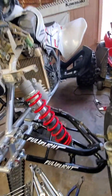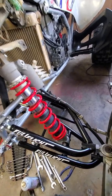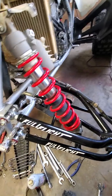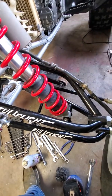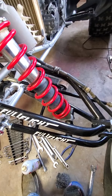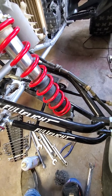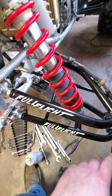A lot of people asked, when I was looking at these, if you can use the stock brake line. Now, again, these are the plus 2, and you can run through a full range of motion here and you're not getting any binding. You still got a little bit of slack. Me personally, I'm probably going to go back with some longer lines, probably steel braided hoses, half for looks and half for peace of mind. Yes, this would probably work, but it's not that big of a job. The biggest part of doing the front brake lines is just getting them bled out. Buy a Mighty Vac for 40 bucks, problem solved.